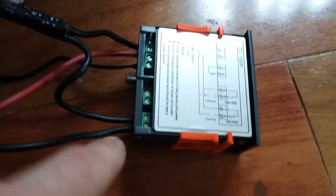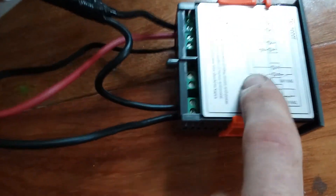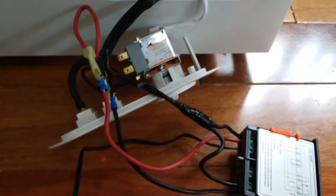Temperature sensor is three and four — it doesn't matter which way they go in, any wire in any hole, just tighten them down. So: power in number one, also branched off to number seven, neutral in number two, and the thermostat output comes out of eight. That's it — very simple.